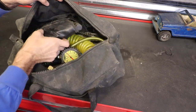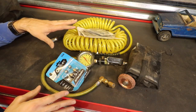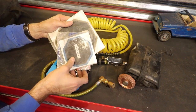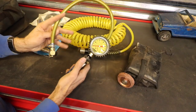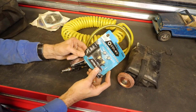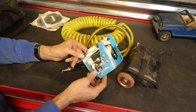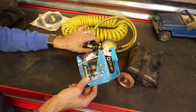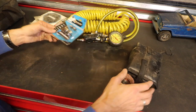This one's probably my favorite bag — this is my tire bag. In this bag I have everything you need to air up your tires or fix a patch. I've got a bunch of different size patches, an air hose for the power tank, and the gauge for the power tank. These are called the Ultimate Tire Valve System — the Colby valve — and you can replace the valve stem from the outside. On a trip a couple weeks ago, I used more than I had because people kept tearing their valve stems off.